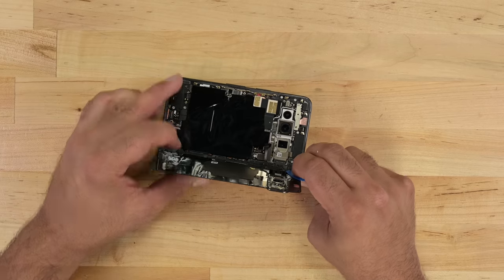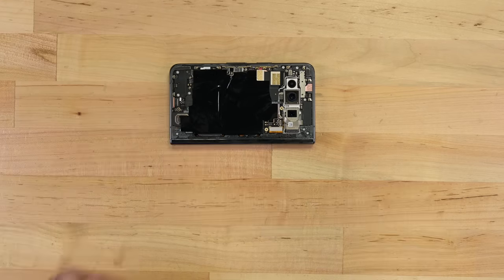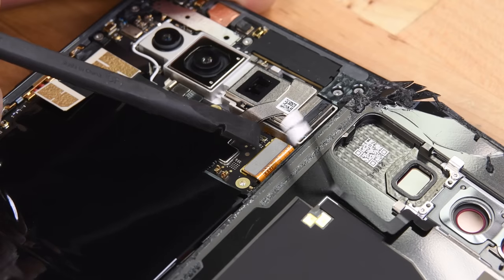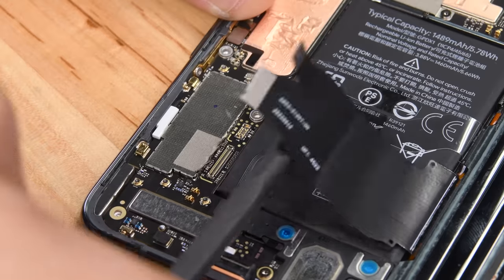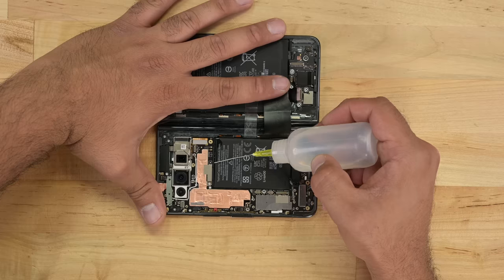With a relatively easy front and back panel removal process, we might well be looking at the first foldable smartphone with reasonably accessible batteries. Assuming the foldable panel holds up, the next most likely failure point on this device will be the battery. Digging through cables and connectors reveals a secondary cell and a battery pull tab similar to that in the Pixel 7 — but in my excitement, I pulled the tab out.